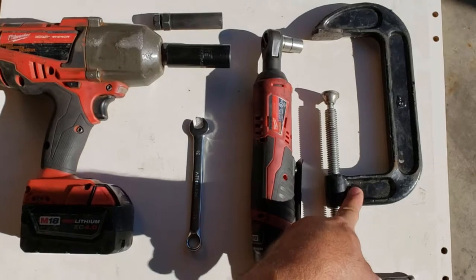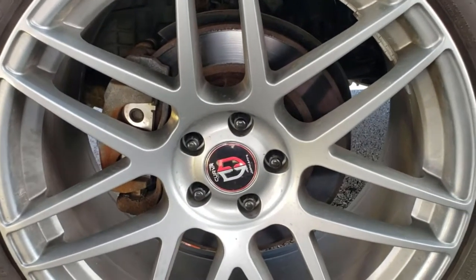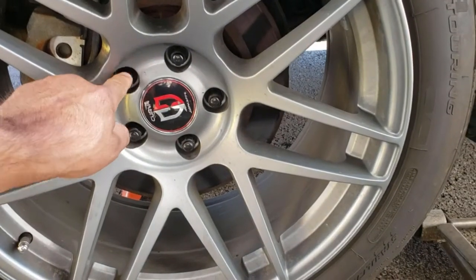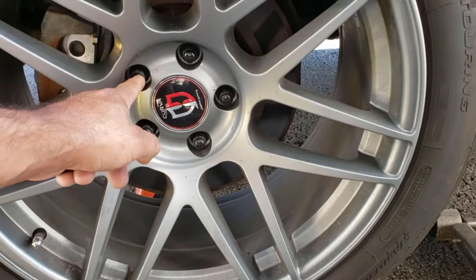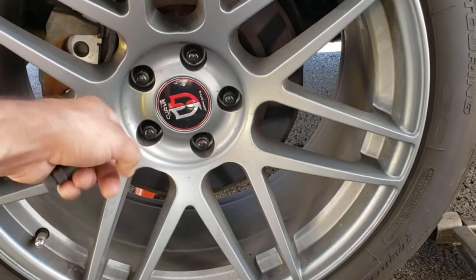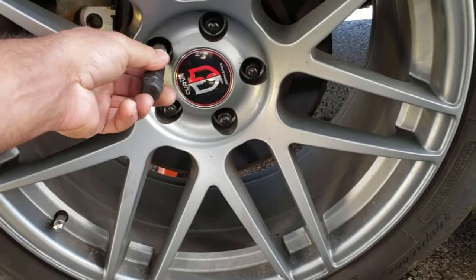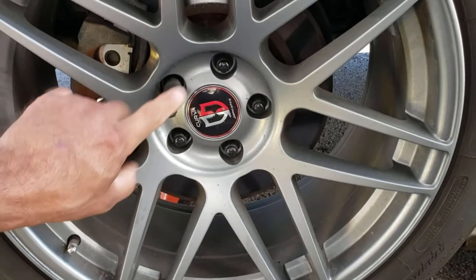A C-clamp is to push the pistons back in. This vehicle has aftermarket wheels — these are 20-inch rims. With aftermarket wheels sometimes you have to run a special lug nut. The seat of this lug nut is a different conical degree than factory. These are actually a 60-degree acorn nut — specifically a splined acorn nut. To get that off you use a key; inside there are splines, and then you use your standard 4-way or impact to turn those off.